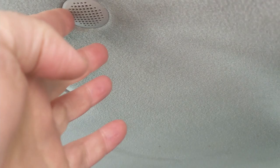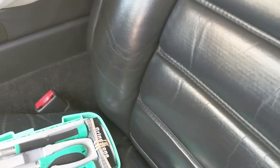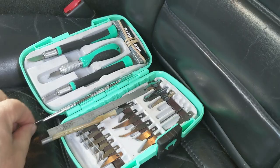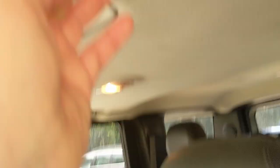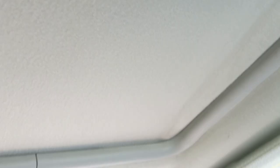In the roof here is the aspirator. I've already got a cushion to sit on because you need to sit on the center console. I've got some tools — flat blade knives, some picking tools, and a small steel rule — to help remove the wiring and connector. Slide the visor back on your roof, pull off the trim which comes off really easily, and underneath are some Velcro pads. You can hear it prise off, and now we're inside and can get to the aspirator.